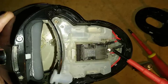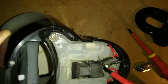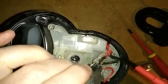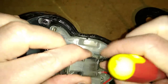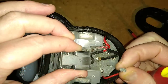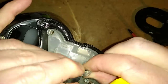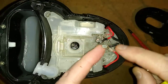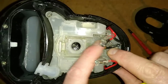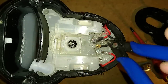Here is the switch itself. There's an LED down there. To change the switch there is one screw located down here - a short screw - and once undone the whole switch lifts up. There are two connections either side: two wires on that one, one is for the LED, and the other is the power to the kettle element. They're both on blade terminals that are quite hard to get off, but this one's a double blade terminal because it also powers the LED. It looks a little bit corroded underneath, which wouldn't surprise me - it is a kettle after all.